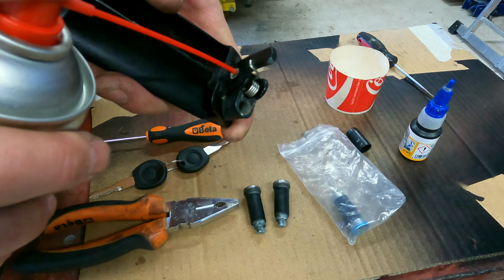So now I'm going to clean a little bit. There is a spring in this place, and in this one there's no spring, so I have a tool missing. Those are so tiny, I shot it somewhere. I try if I could take off springs from here. I think they should drop there, yeah. But the springs in the new Chinese lock are smaller than the springs in here. It's going to be quite tricky. Better I use this pin here, so I can install them one by one. And then the upper side, and then the last one.